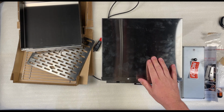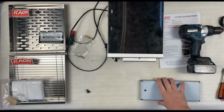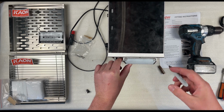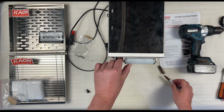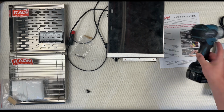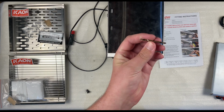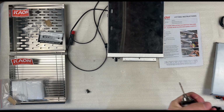There you have it. So we're going to do the install of the door and chuck it in the car. All right, so we're going to chuck the door on. We're going to center up the cover over the existing door. Take our marker, mark the holes. Got a battery drill. Take the drill bit supplied in our packet. Yeah, double head one. So we can't stuff this up.